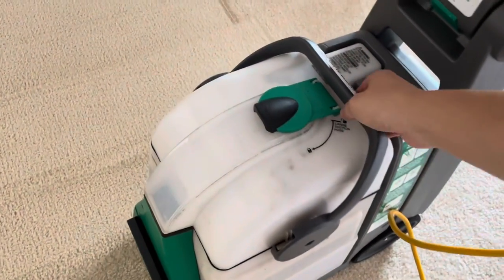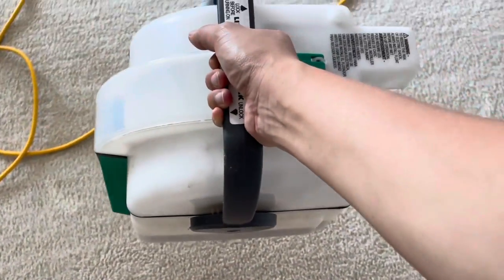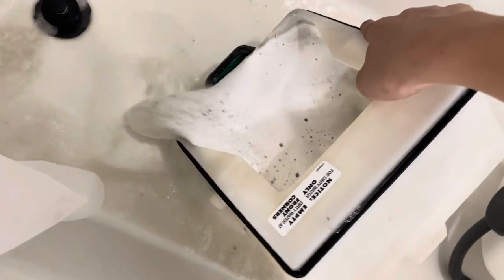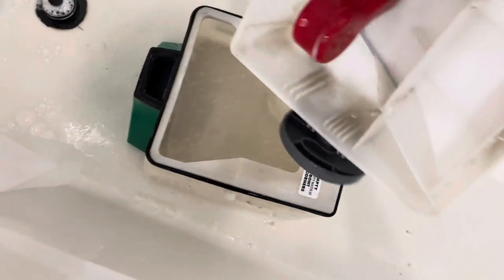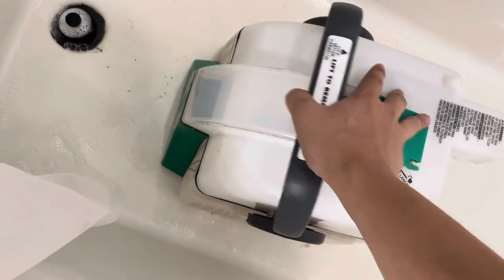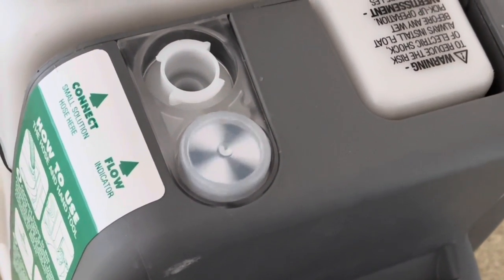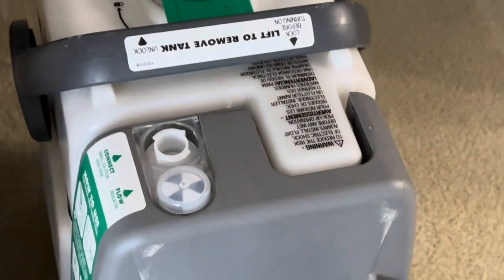To clean the tank, all we have to do is lift this up to remove it. We'll take it to the bathroom and lift the top off, then pour all of this out. Over the course of cleaning my house, I had to empty this tank at least eight times and refill with solution about eight times. To put the cover back on, slide the handle forward to the unlock position then slide it back to lock it so you can carry it as one piece. While cleaning, make sure the flow indicator is spinning — once it stops that usually means you don't have any solution in the lower tank, and it's time to refill with water and solution.